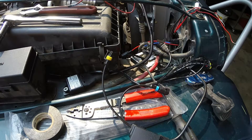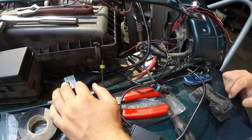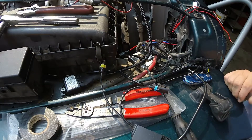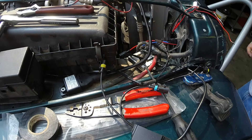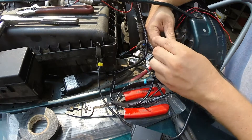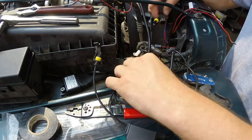Whenever you're ready, you're going to lay out all the wiring. It is a lot. I like to put the main box right between my air box and the side of the fender — just put a screw through there, and that way you're within reach of your battery, you don't have to extend anything, and it's kind of tucked in there. This was the way I had it set up on my old HID set. You're going to go through and see what fits what connector. They're all different connectors so you can't connect the wrong thing.